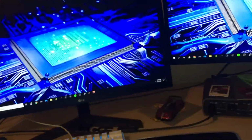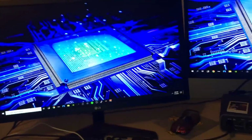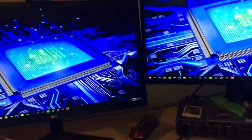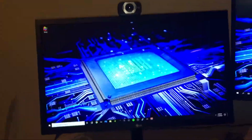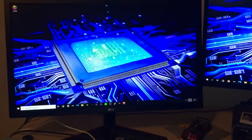One thing I almost forgot to tell y'all, when I finally got everything up and running, I had the Activate Windows watermark, and I wound up using an app called Produkey. I tried to use Command Prompt, and basically the key that it gave me was, I guess, the one that they used in the HP factory to install Windows 10 on a bunch of machines at once. So that was not the right key. So I used that Produkey thing. There's a bunch of different applications and software like that that you can just download real quick, get your Windows license key, and then activate your Windows again.